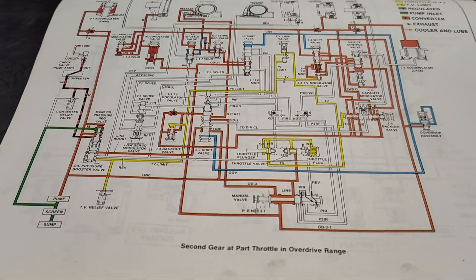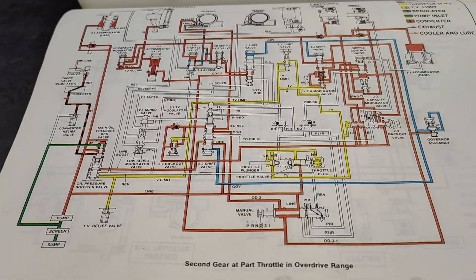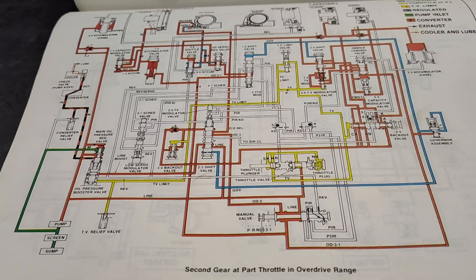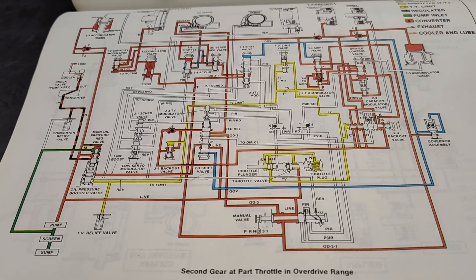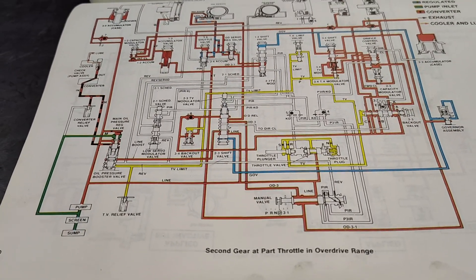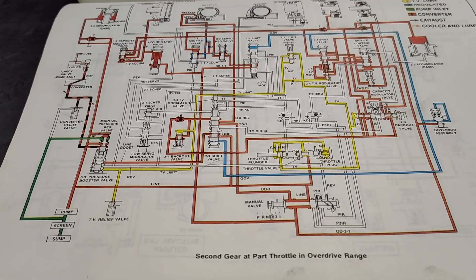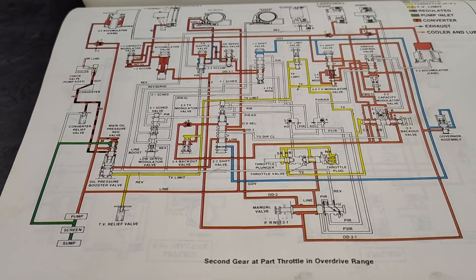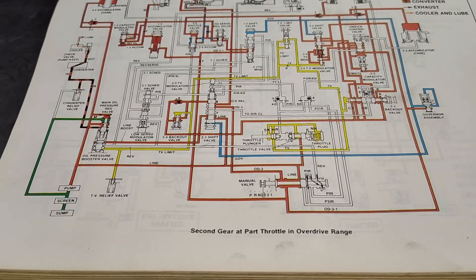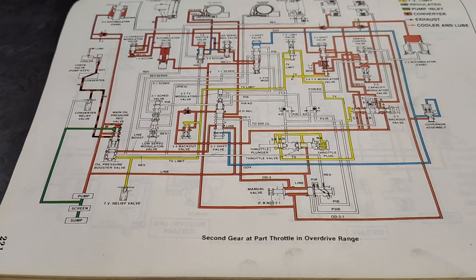If you're a guy who bought an AOD from someone and you're putting it in and know what you're doing, don't be so quick to blame the builder. It may not be their fault. I know so many guys that just won't build these anymore because customers have done this to them. The 700R4 is the same way — and honestly, that transmission may be more important to go fixed pressure. That 3-4 clutch is wimpy. But anyway, we're talking about AODs, so I hope that makes a little bit of sense and helps you understand what fixed pressure is.